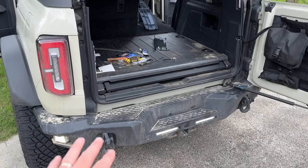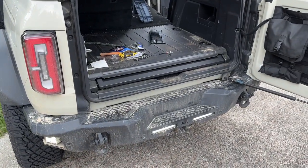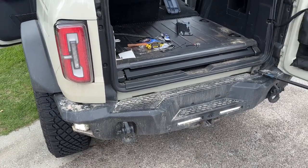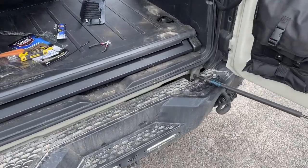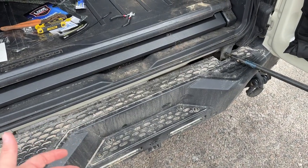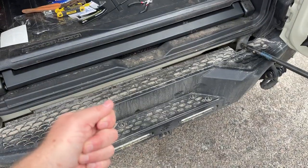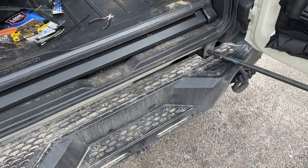In this case I put a Rough Country bumper on and had to rewire everything. Rough Country's instructions are pretty good, especially when you have parking sensors. First thing you've got to do is wire it all up — make sure wires aren't touching metal, use electrical tape and butt connectors that can be heat-shrunk to hold the wires together really well. That's the kind I use.